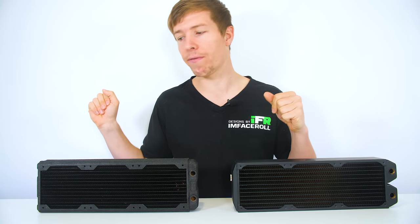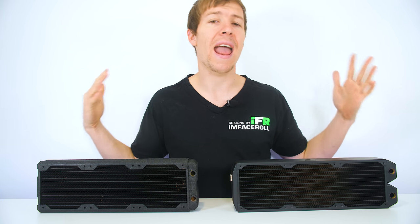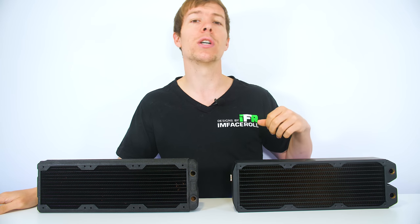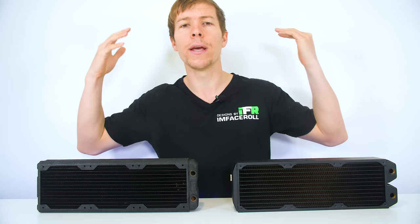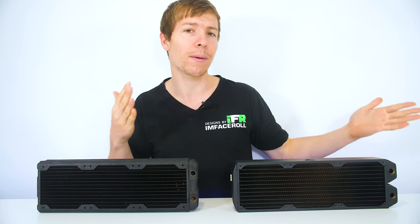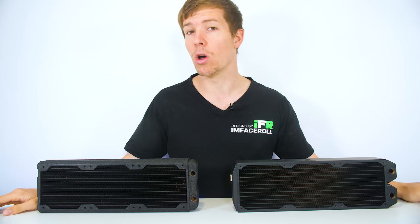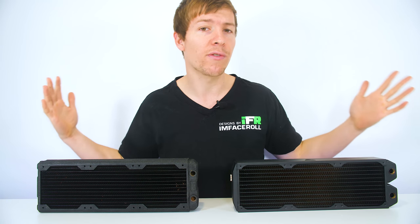Are there any negative effects of having a radiator with a greater FPI? This all has to do with static pressure and airflow. On the market there are two different types of fans you can really look for: ones with really good airflow or ones with really good static pressure. Airflow fans are great for case airflow, getting the air through and dissipating the heat within the case. Those airflow fans would be better suited for the lower FPI radiator, because there is actually more room for the air to get through. It also means you can run those fans at lower RPM because there's no pressure for the air to get through given the room between each fin.